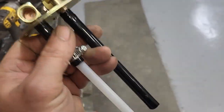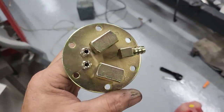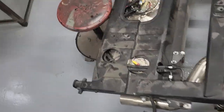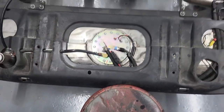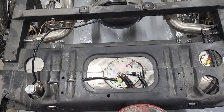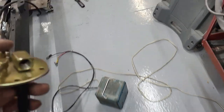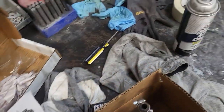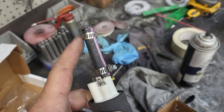This is a typical traditional fuel tank setup, but mine has a large ring — like a three-inch ring — substantially larger. So I just put the pump on my setup. The only other thing is they use this high pressure line, whereas on my original pump it was just a rubber hose for the supply, for the outlet side of the pump.